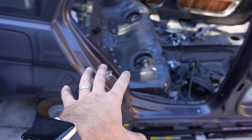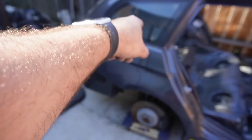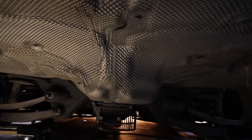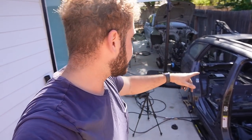We got the M3 fuel tank, the M3 rear suspension, the M3 DMTL pump relocation for the quad exhaust exit. Check that out, guys. So I found out to actually get an M3 muffler mounted, I'm actually gonna have to de-weld the brackets on that and reroute it on this guy. It's just like four little brackets. It shouldn't be too hard to de-weld and then reroute it on that and weld it on this. So that's stuff that we're gonna have to do to be able to get the M3 muffler mounted like an OEM mount. We could just get it welded up, but end of the day, if we can get as much OEM stuff as possible, we might as well. Especially if we have a donor car, we have the stuff, why not just get the work done, especially since we're going 110% on this build.